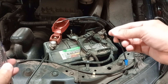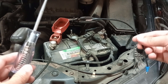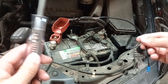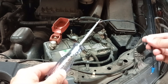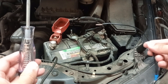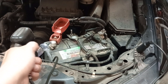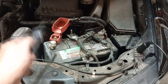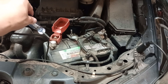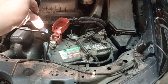I've got a wire here. Obviously this wire has no power. But let's say I wanted to test if this wire has power or not — I'll touch the probe to it. The light bulb doesn't light up, so I know there's no power. But that positive battery terminal there, I know it has power, so if I touch it with the probe, the bulb will light up.